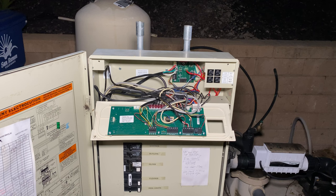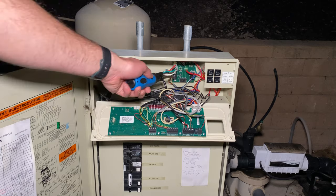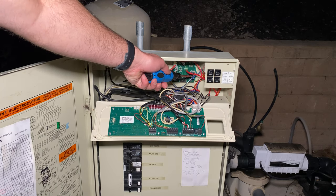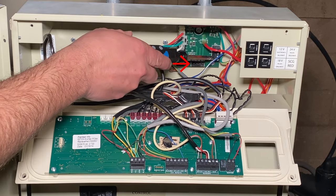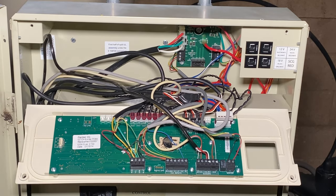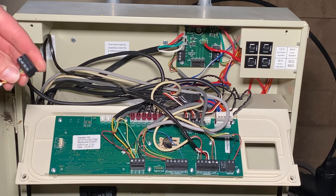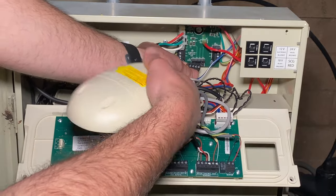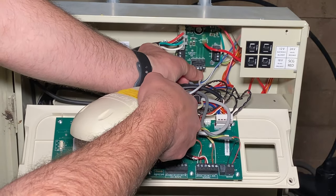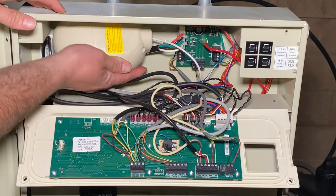Now with a flathead screwdriver, remove the two screws on your control panel. The panel is a drop-down and it will reveal the install location. We'll want to clip our small plastic black connector to this area of the board. But first, you need to route your white wire from outside the control panel back into it so that we can mount the antenna nearby. If you mount your antenna inside the metal box like I do here, don't expect exceptional range, but it actually did work fine for me for 50 feet or so. Next, we attach this small black plastic adapter to the end of the antenna wire and connect it to your control board.